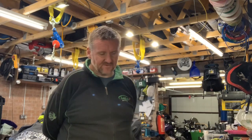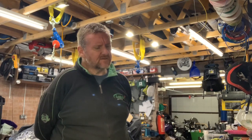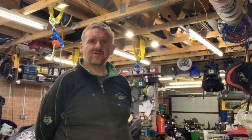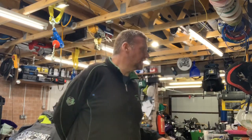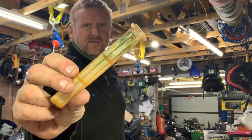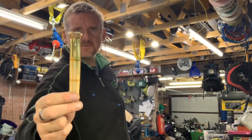In the process I had to take the fuel gauge sender off and the fuel tap — the petcock — off. The filter on it was absolutely gunked up and destroyed, with loads of green deposits, which I think is from the brass tubes on it. The fuel tubes were blocked so I stripped and cleaned them. I couldn't get a new fuel filter to fit the petcock — as you can see it's in a sorry state and it's broken as well.